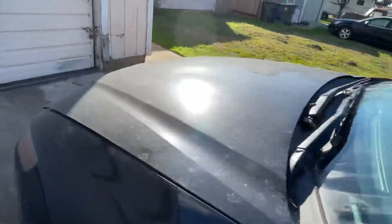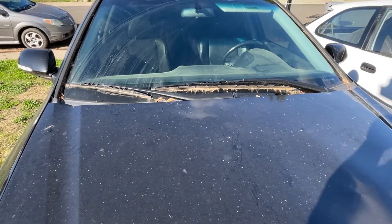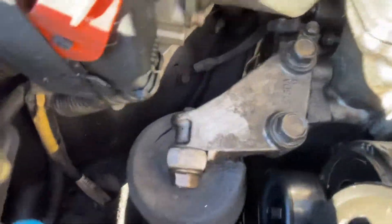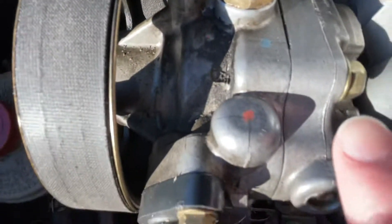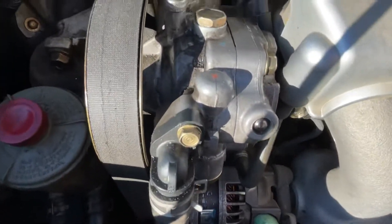I'll show you why it was so cheap. There's a weird little latch here for the hood. So there are two problems: one, the power steering is leaking, and two, the motor mount has a massive crack — right there in the back and below that part. And the power steering is leaking right here — this gasket right here is leaking.